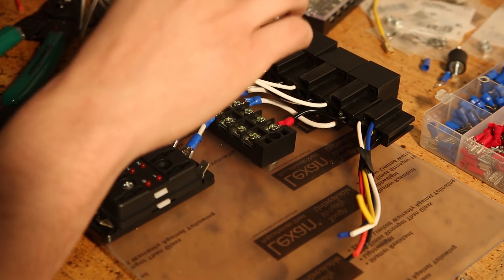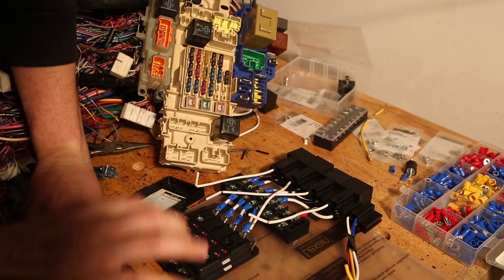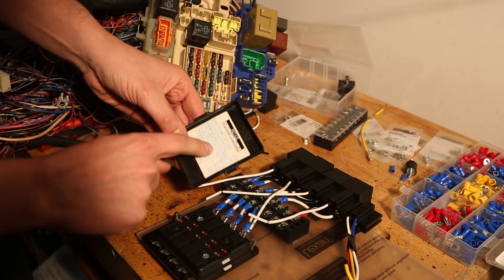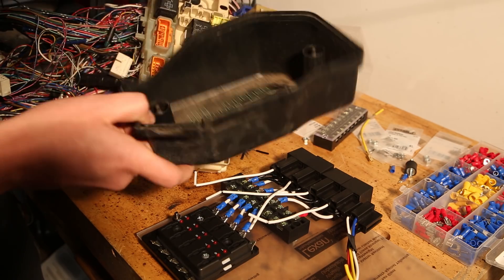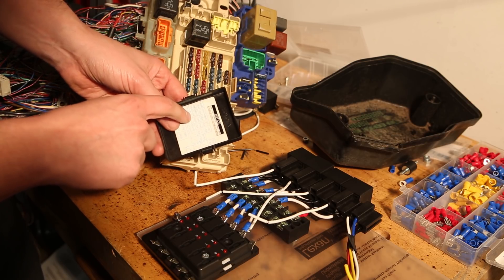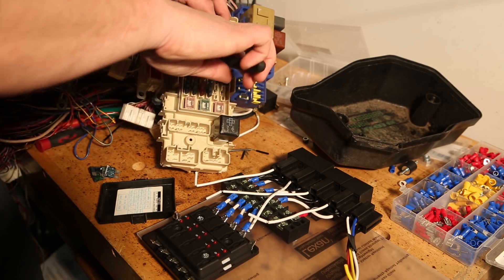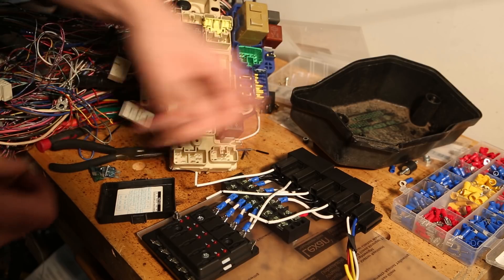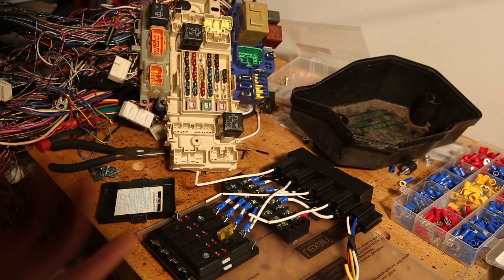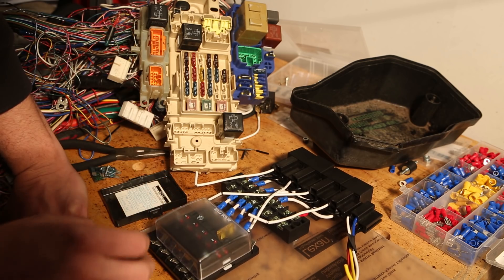For these fuses I brought in my factory fuse block from the SC. I have all my factory fuses here and the internal fuse diagram, plus one from the engine bay which is really nasty after being outside for about two years. I can go through here and figure out what each part of the factory car requires in terms of amperage and then pull one from there and pop it into here. For example, my wipers require a 20 amp fuse - these yellow ones are 20 amps - so I'll steal this from there and make my wiper relay slot this one. It goes down to here, goes into here, and now I have my fuse ready to go for my wipers. All I need to do now is go through and figure out all my other fuse requirements, pull them from here, pop them in, and I should be pretty much done.